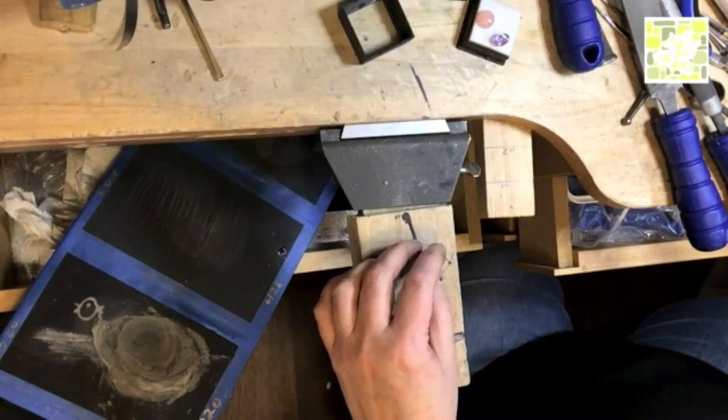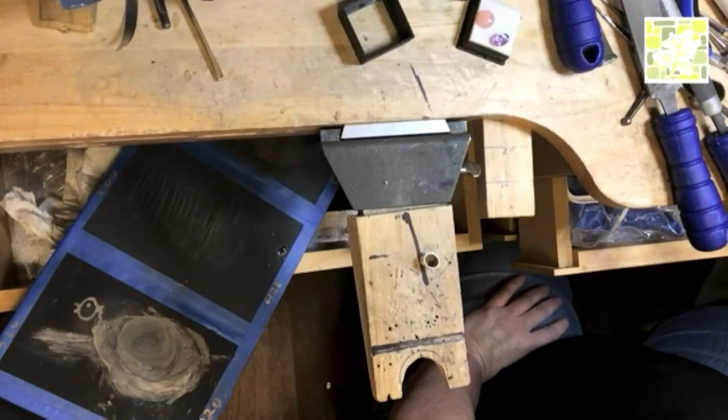What I'm looking for is a cutting compound. I think ZAM might be a blend of cutting and polishing. A cutting compound will have a little bit of grit to it, so the grittiness of it is what you're looking for. It feels like it has a little sand in it. Gotcha. That one takes material down more than it polishes. And what it does is it buffs and blunts anything left over from the scratches you've got.